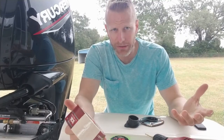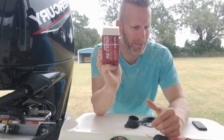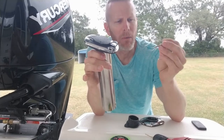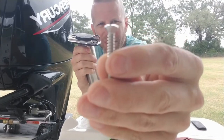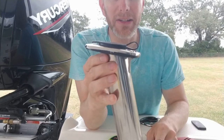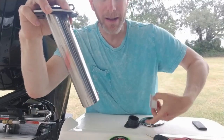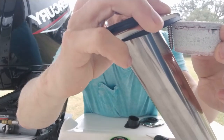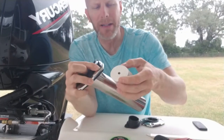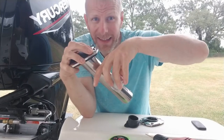Here we are, day two. It shouldn't have taken two days, but always make sure you have the right stuff. I did pick up some masking tape - the electrical tape would have worked, but this is a little bit easier to draw on. The screws that came with the rod holder were too short, so I ended up getting one and a half inch long number 12s with an angled head, which will sit better into that angled hole. I took my rod holder to the hardware store so I could line up the screw, and it goes just about all the way through without sticking out below the fiberglass - which is what you want so it doesn't catch on electrical or fuel wires.